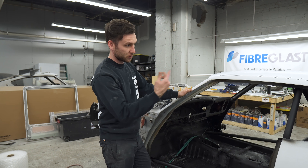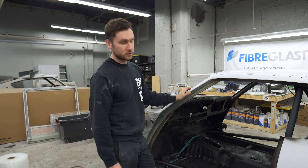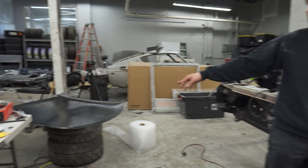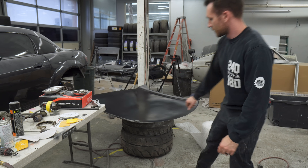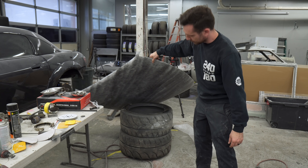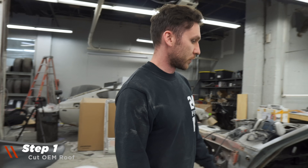Except for the roll cage and the inside of the roof, which will still be visible carbon. We've sat and cleared our roof, and the bottom half has been worked quite a bit and primed. The black stuff you see on there is just guide coat for the primer so I know where to sand.